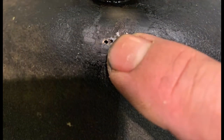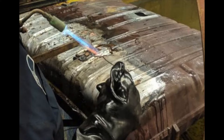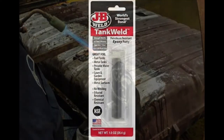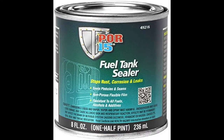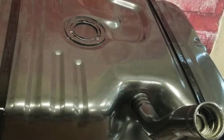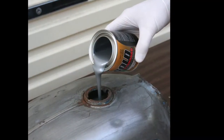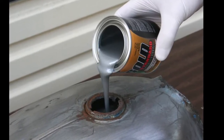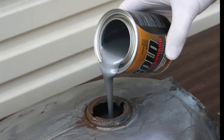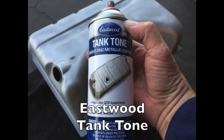You will need to fill these holes. With a completely clean tank, you can apply new solder yourself with solder-melting heat on bad areas. Some people use JB Weld, which seems to hold up quite well. Por 15 fuel tank sealer also works well. On another note, powder coating the outside won't stop rusting, as tanks rust from the inside out. Coating the inside with an epoxy or polymer type coating is available, but there are nightmare stories about some ceramic coatings that have flaked off and trashed carburetors and fuel pumps. To give the tank a clean look, paint the outside with Eastwood Tank Tone.